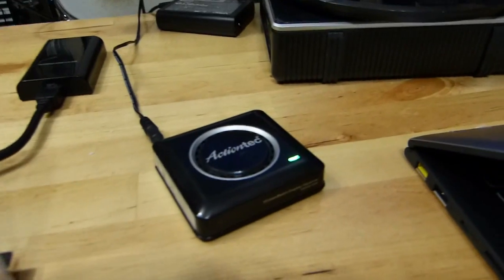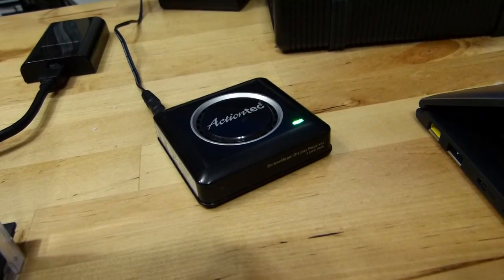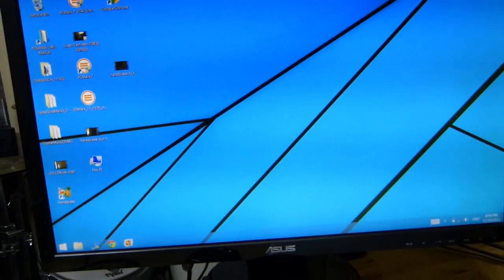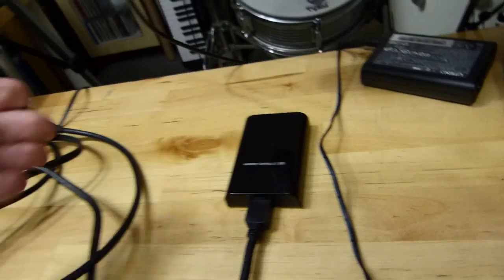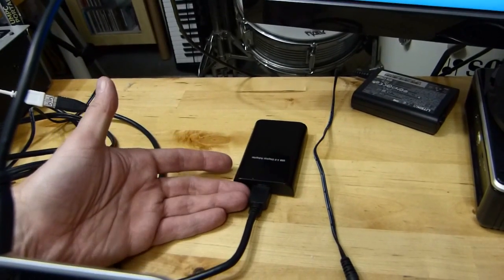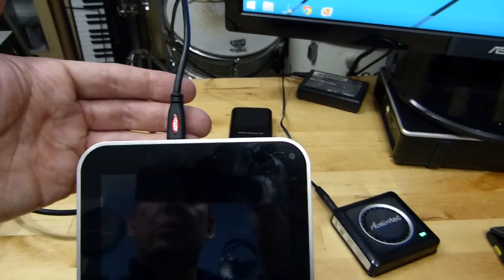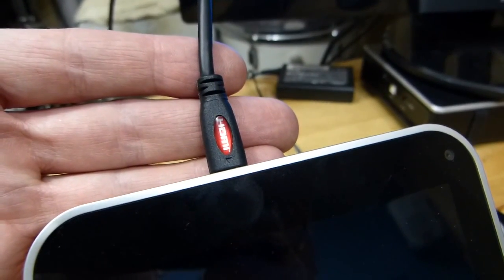So there you are. Miracast will bring you your video in reasonable quality. It doesn't have a CPU overhead, and that's nice if you've got a huge screen on the other side of the room or a projector — you can just connect wirelessly. The second option is the USB 3 display adapter. Bear in mind the USB port on this is actually USB 2, not USB 3, so you're not getting the full capability, but it drops back to USB 2 support. The third option is the best quality, and that is the micro HDMI port — buy the cable or adapter and use the built-in micro HDMI.